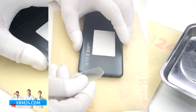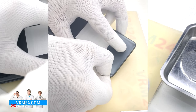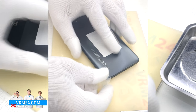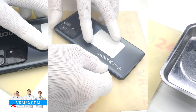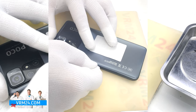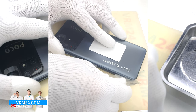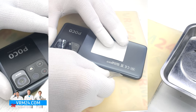After 5 to 7 minutes, we can move on to detaching the back cover. To detach it, we use a thin plastic film — it is a protective film for a new display. We insert it into the gap between the middle cover and the back cover and slide it along. The adhesive base has softened after heating, so it is easy to detach the cover. We can also use a thicker pry tool to get the cover off faster.